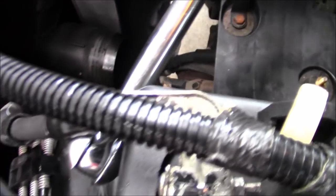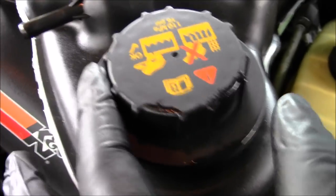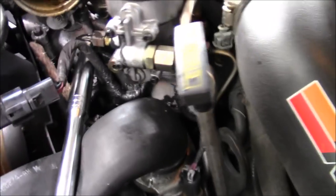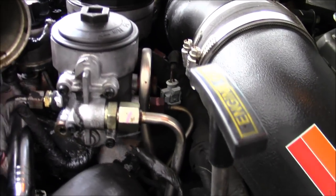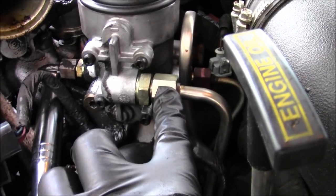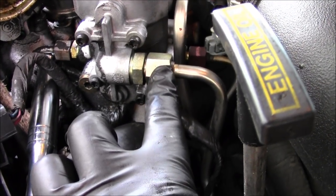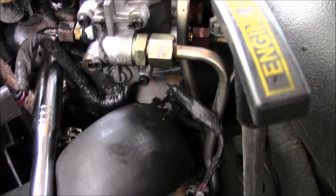What I did was put my pry bar right underneath that line very gently, and pressed down to set it underneath that battery cable right there — just as I've seen done previously. That basically holds the radiator hose down and prevents you from having to drain the entire coolant system. Just make sure you relieve pressure in your cap first and be really gentle. That gives us a free area to easily access the regulator. Next step is to loosen this fuel line — always put a wrench here first, and don't just smack it. There are horror stories of guys twisting this line.